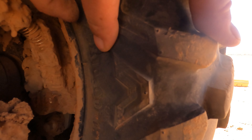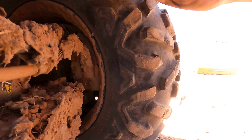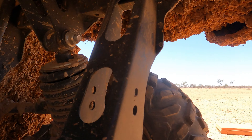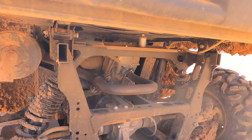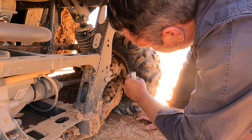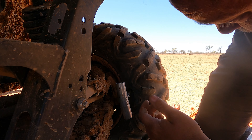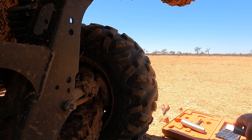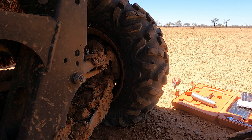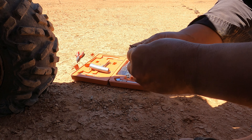As you can see here we've got a big tear in the sidewall - hopefully you guys can see that. But we're gonna plug the shit out of it. Shane's gonna have to hold that. So what we're gonna do is just try and work out exactly where... see, that's that hole there. So we're gonna jam this into the sidewall there - like so. All that'll do is just open the tyre up a little bit, make it a smidgen easier to get the plug in. So these are the plug strips - they're a bit of a pain in the arse to be honest, but when you don't have a choice you just deal with it. Alright, now the hard part.